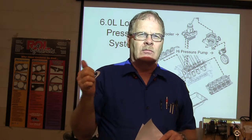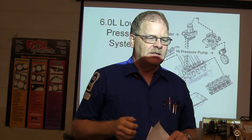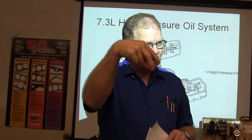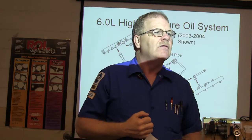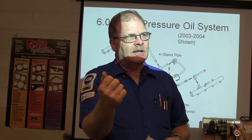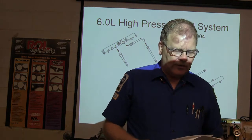And we had a Taurus over here one day. We needed to replace an inner tie rod end on, and we absolutely could not get that thing to budge. You might notice that one of my big wrenches in here is bent. The head of it's bent at a 90. I put that on there, and we had a big pry bar in the end of it trying to break that thing loose, and it just absolutely would not move. And so we got the torch and put a little heat on it, and I guess we melted the Loctite or whatever, and you can just screw it off with your fingers. You know, so that's the only time I ever run into that.